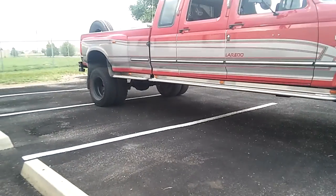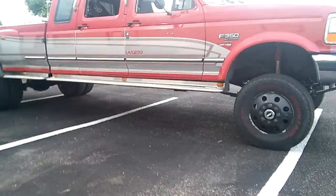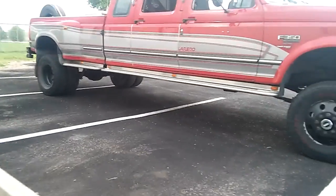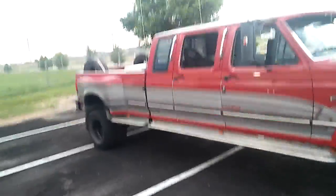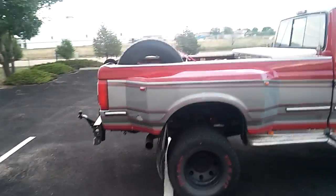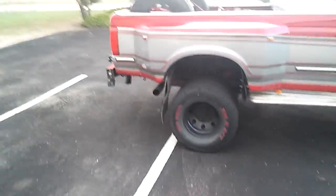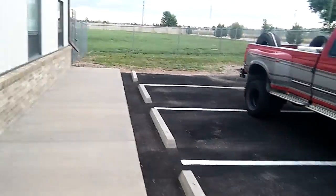Ask anything at all, like what size tires I run, how I'm running that size tire, how the ride quality is. I used all grade 8, grade 10 bolts if I could find them. I found them and I put those in there. Anti-seize everything, anti-seize, anti-seize, anti-seize everything. You don't know how much that's going to help you out 5-6 months from now, especially if you live in the north or somewhere where they plow and it snows. Anti-seize the shit out of it, it's going to save you time on the back end.